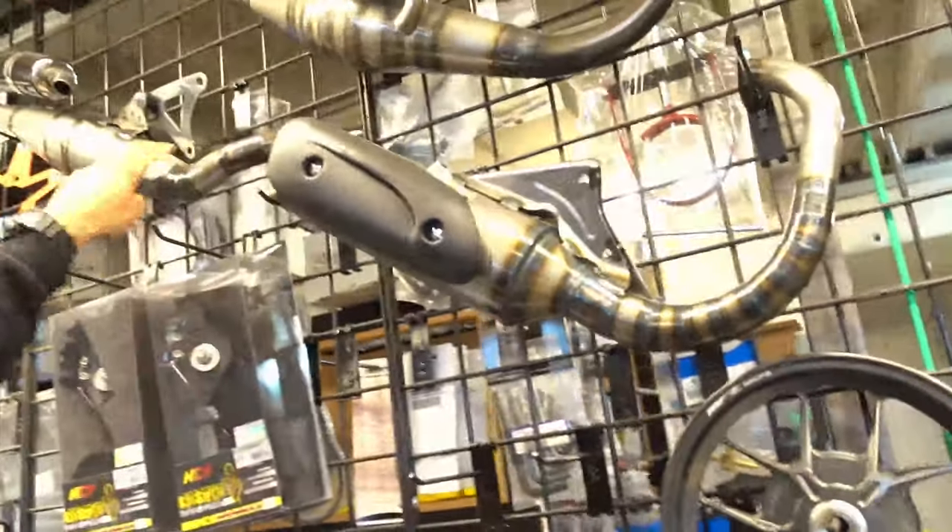That bike has probably the most — in fact it does have the most — amount of parts you can get for the Yamaha Zuma as far as performance goes. They're pretty easy to make go quick. We have tons of parts: pipes, cylinders, everything for them. The couple of downfalls are it's pretty hard to go disc brake — you have to change a lot of things over. They don't make drop-in replacement forks, though we do sell shim kits to allow NCY-style legs to go in. As far as aesthetics, there's little you can do without more custom work. But the motor is great — it's air-cooled, and both those Zumas are air-cooled.